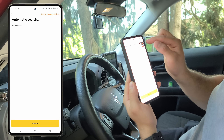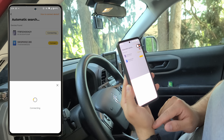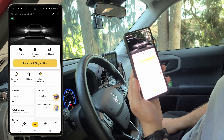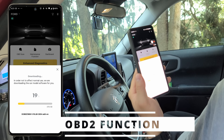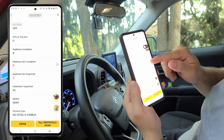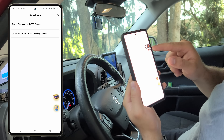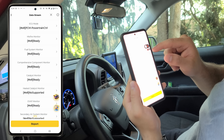Now we'll go ahead and actually connect to the scanner — it's already plugged in. You'll see it populate in your list, click connect, and sure enough we hear the beeps, so we know we are connected. We'll turn on our vehicle and try the OBD2 functions. It'll download some packages and instantly give us scan results. Tapping 'Enter' gives us more information and functions like the inspection and maintenance readiness, which tells us if we're ready to pass vehicle inspection.